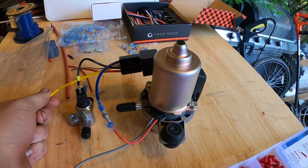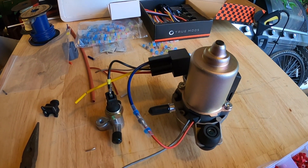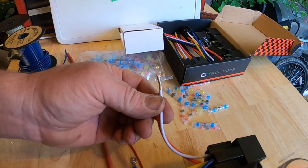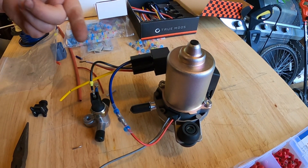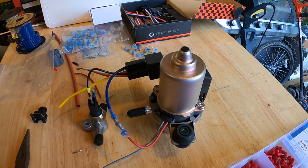Are you sure you don't want an on/off switch to run into this? No, because that's not the way this relay works. So this is going to be power — when you turn the key on it will provide power to this and the whole system will work. When you cut the key off it will shut the power to this, so it won't run when the car is not on.